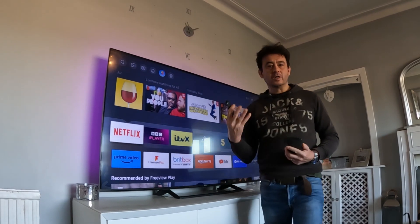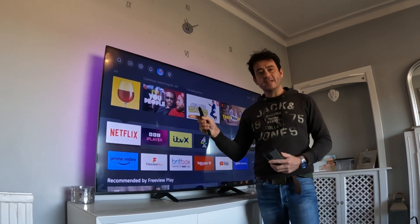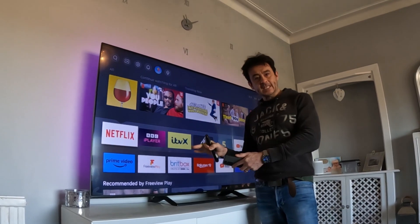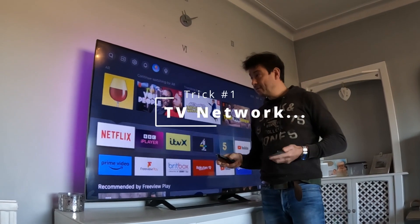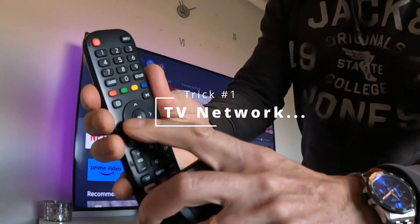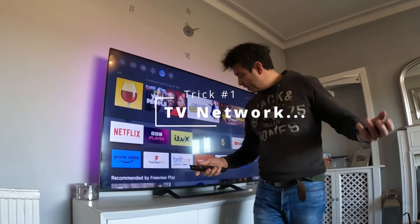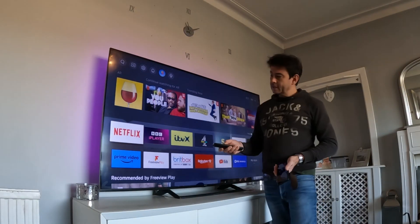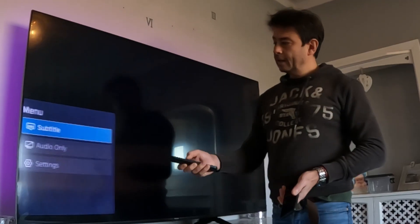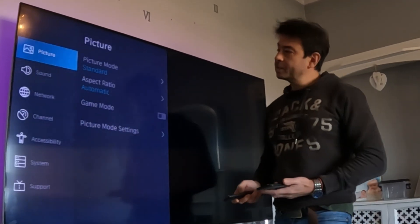Getting a few people asking me they still can't connect with the cast button, so try these things. First of all let's start with your TV. Let's make sure that your TV is connected to the same network as your phone. The simplest thing to do is go into the menu settings. So let's go into your menu and go down to settings, then check the network settings and see what we got.